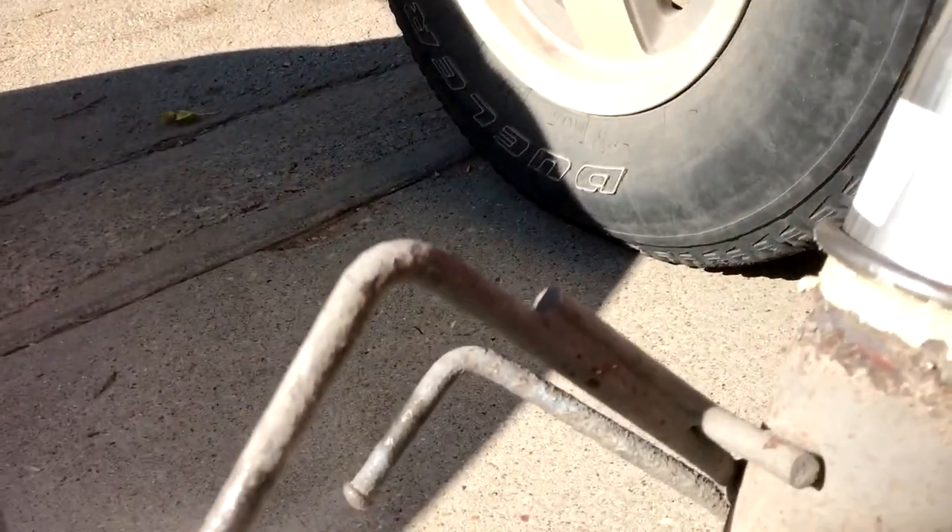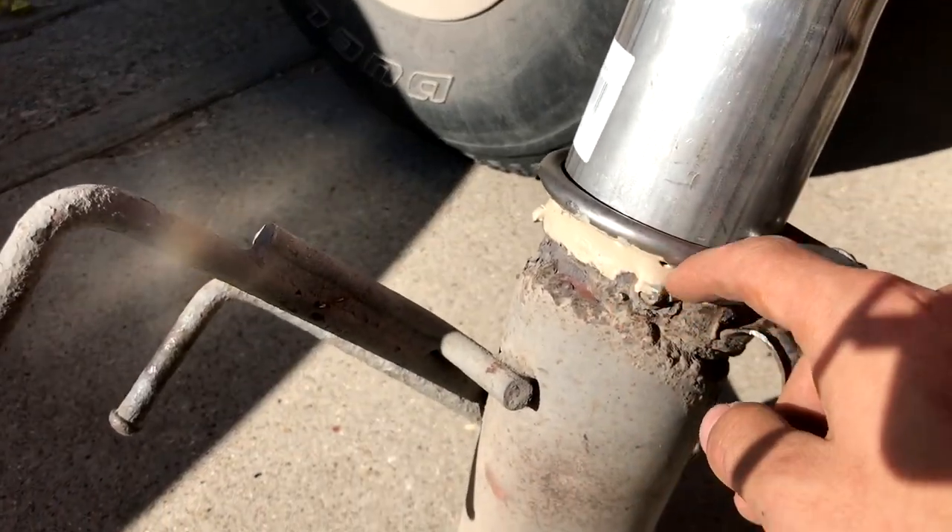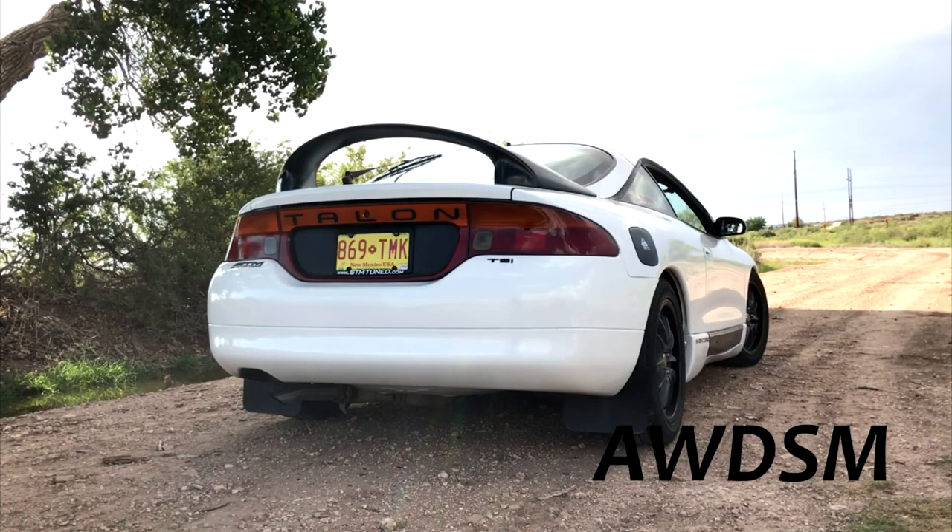We got this thing dried up — it's nice and set, just like a weld, like it said it would, so that's good. We still have to throw that back on. I'm gonna wait to fix this oil leak, because Mitsubishi has these crush washers that go on the bottom of the turbo drain, and that's where I'm leaking from — the bolt holes. I thought I was leaking out of the AN hose because I have a dash-10 fitting coming out of there and a return line. I was looking and you can actually see it bubbling out. I'm gonna end the video there guys — thank you for watching, subscribe, like, and you guys have a good day.